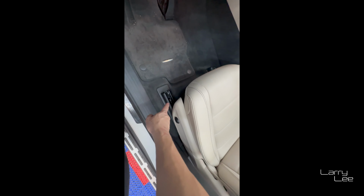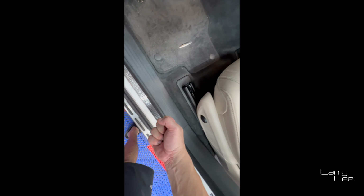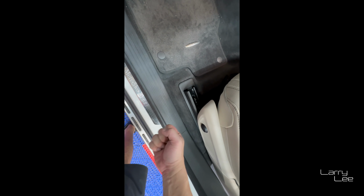Okay, so everything's back together and torqued and everything. I don't actually have the torque specs for these guys, but what I did was pre-tighten and then another quarter turn. Well, more like an eighth to a quarter. Make sure we don't strip these guys, because there could be big trouble if we strip these. But pretty much it is reverse order.